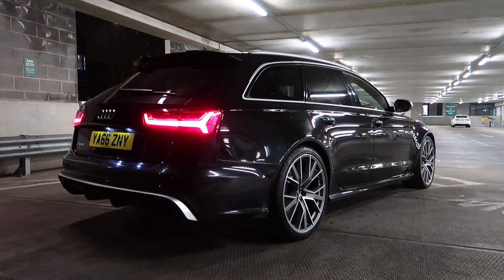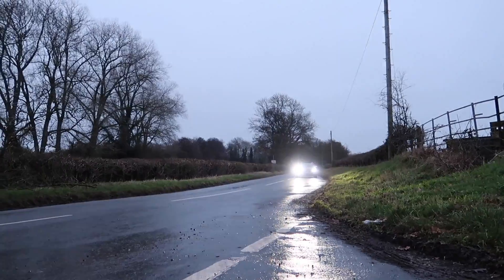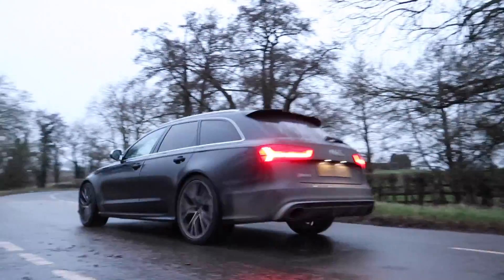The specification on this one is exactly how I'd do an RS6 — I love black cars with a bit of silver contrast. One key difference with one of these versus something like a smaller RS like an RS3 is you get proper Quattro here — a sport diff at the back, not a Haldex. So the car is quite tail-happy if you want it to be. You can add power mid-bend and feel the rear bias. The RS4 has this same Torsen-based Quattro as well. When I get on the power I can feel it squatting differently to how an RS3 would feel.